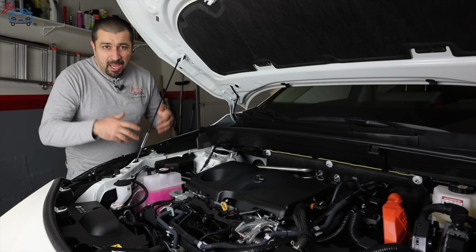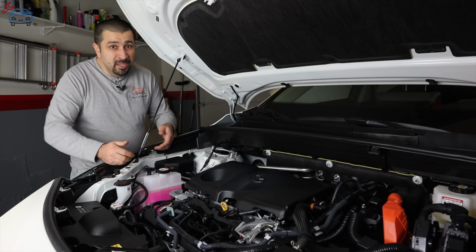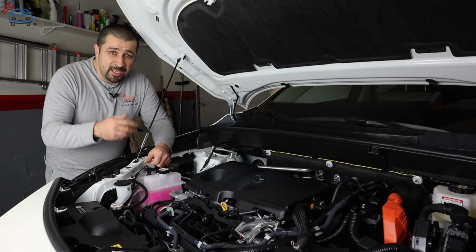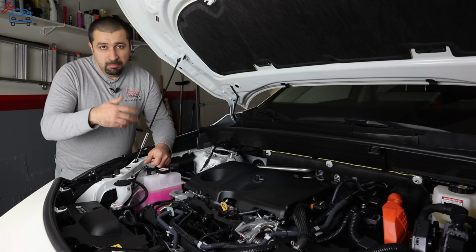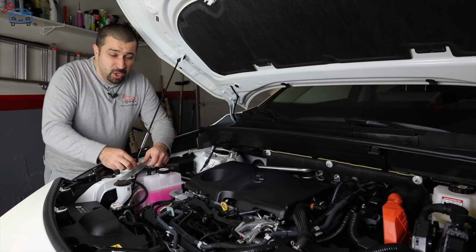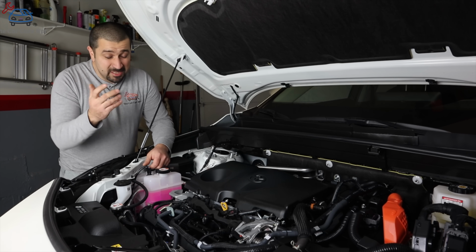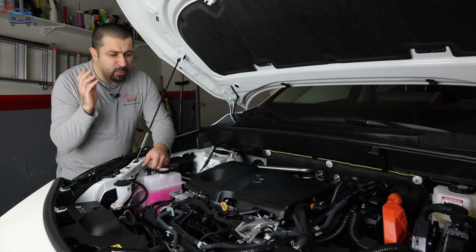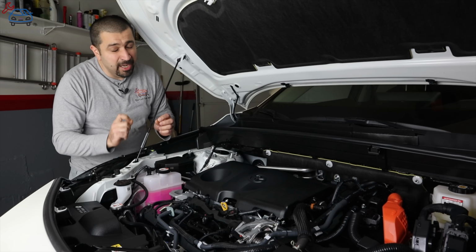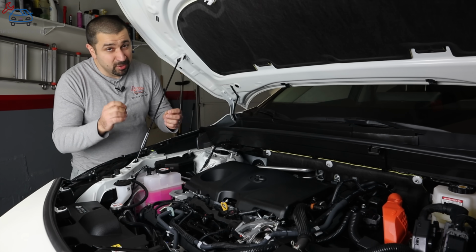And this is not something that happens once, it happens over time, and the more you leave this car overfilled, the more it's going to do that. When that oil ends up in the intake, you're going to get cold start problems, misfires, all kinds of clogging of everything, and all the problems start from something as simple as slightly overfilled engines. So I want you guys to think of this. I'd rather you slightly underfill these engines on Toyota hybrids than definitely overfill them.